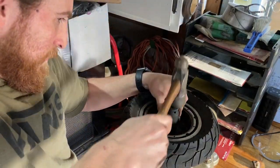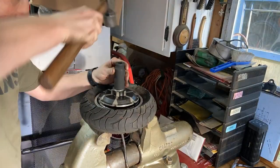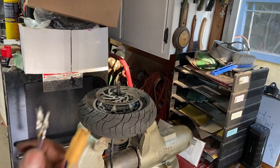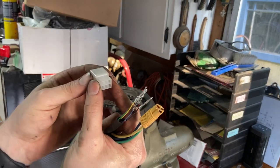Let's get that new bearing in there. Putting everything back together was actually pretty easy — just tapped in the wheel bearing, then used some wheel bearing grease and put everything back in place, screwed the hub down, put the brake disc on, and we were good to go.